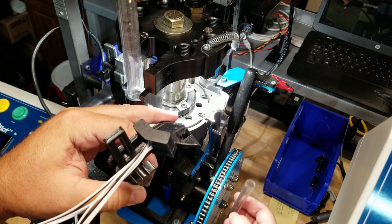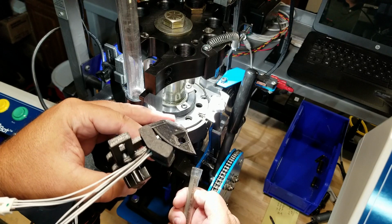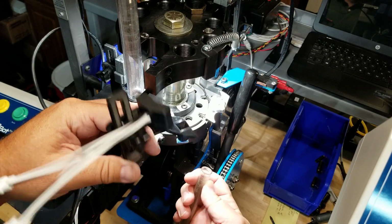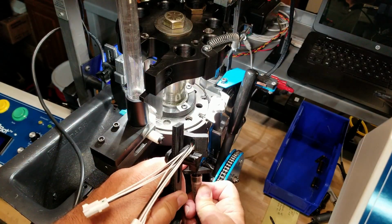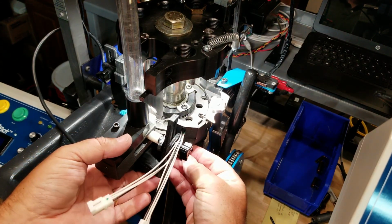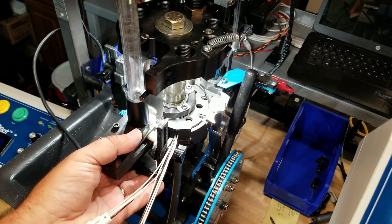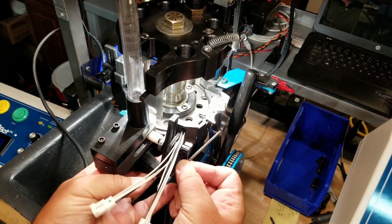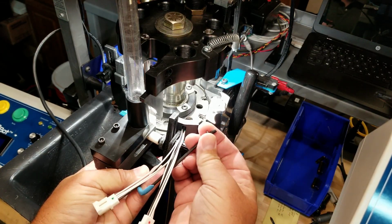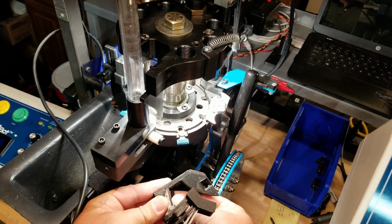All right. Now, like I said before, I've taken heat. This is a 3/8 by half inch drop tube. Just a little heat applied to that and then shaped, pushed on, and a nice snug fit. Doesn't need anything to clamp it on. Just set it into position. Use the screw that comes with it, with the 1050, that holds on that catch bracket right there. Just take the same screw and get your 1/8 hex.